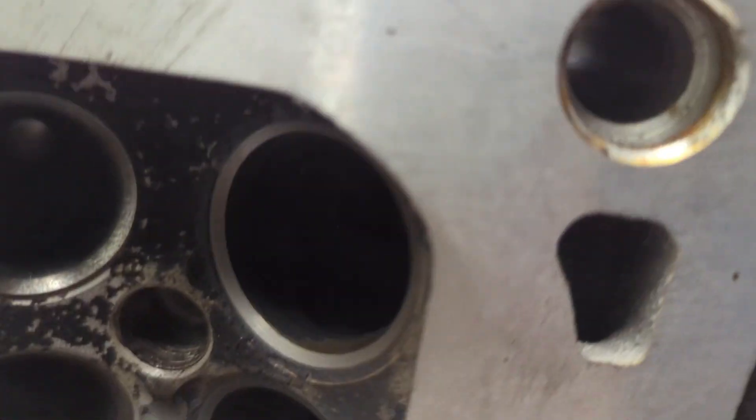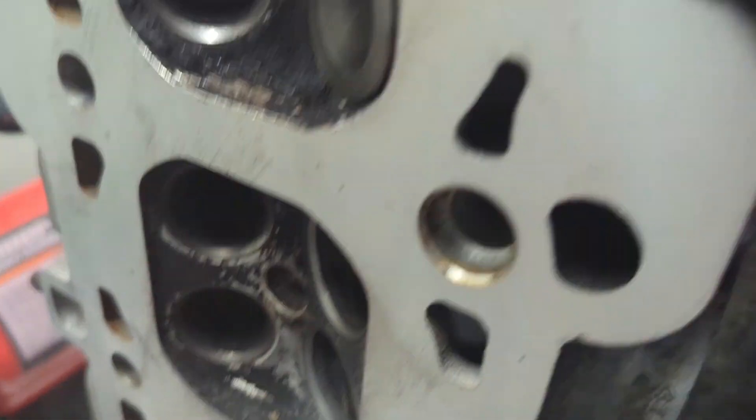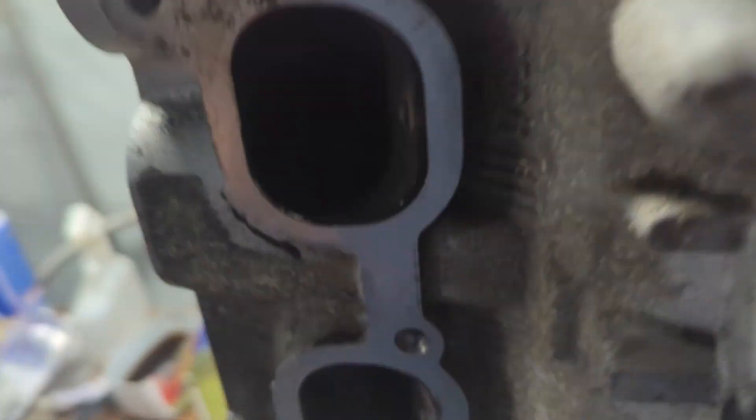We are moving right along. I've lapped four valves. I'm going to go ahead and drop those in after I drop in the valve stem seals — install four valve stem seals, then four valves, and then I'll do the last four intakes.